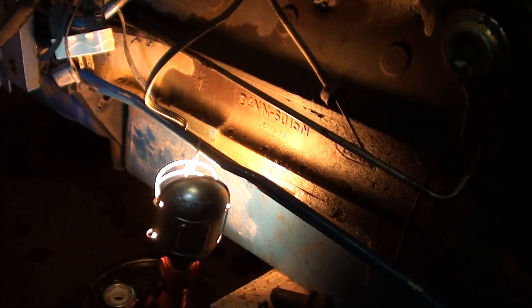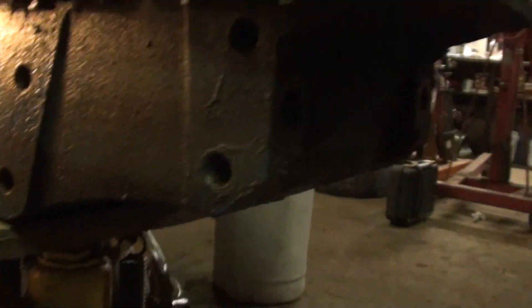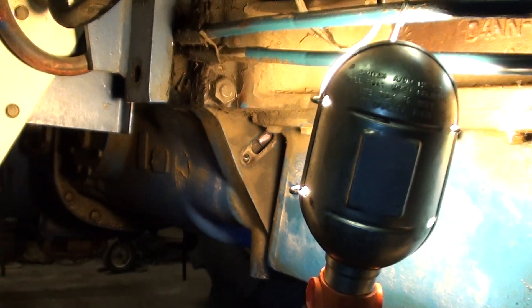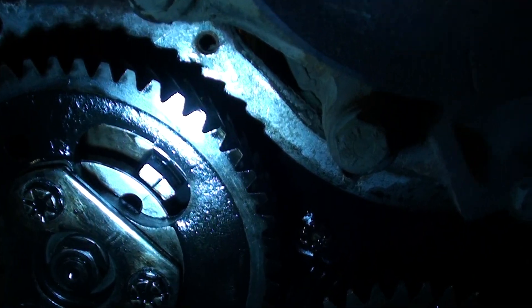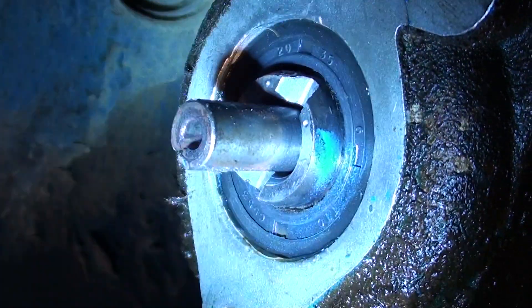The other part of the timing is when you turn that to 23 degrees, which I'll do. We have a three-quarter ratchet on the end of the crankshaft. Just turn that a little bit until it lines up. Okay, that's roughly 23 degrees — you can see there's a pink mark here, which is right about 23 degrees. On the pump, there's also two marks on the front, and they are very close to being lined up. On the back of the pump, we have a mark up here, and then we also have a V-groove down here. They are very close to being lined up. So at 23 degrees, the pump is lined up with the crankshaft.